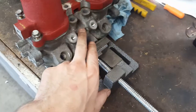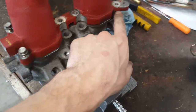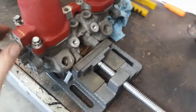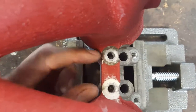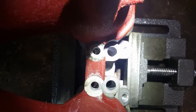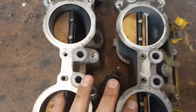You can see this is the 07, by the way, TGV. I just wanted to check if I'm aligned because I'm about to thread the new hole so I can install a helicoil. And you can see I got three bolts in there. Okay, they are in. I got another one here. And these two do not line up. They are about halfway. No bueno.